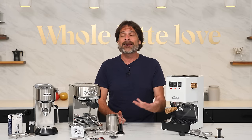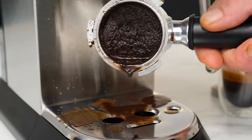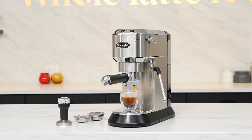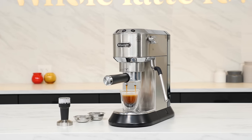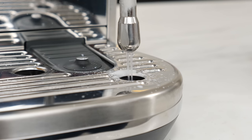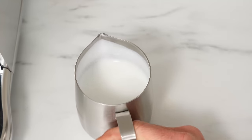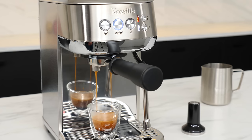So which might best fit your needs? All come with pressurized filter baskets, so you can start without a grinder. When you want to upgrade your quality, you can add a grinder and go non-pressurized with all except the Dedica. If you're okay with average quality espresso, the effort of cleaning out soupy pucks, or know you'll only brew with ESE pods, you can usually pick up the DeLonghi Dedica at the lowest price. If you like convenience and want to froth to latte quality with no skill required, the Bambino Plus does it automatically. Some users will find the automatic purge feature useful — just lower the steam wand and the Bambino Plus takes care of it. Like the Gaggia Classic, it has a three-way solenoid for dryer pucks. Steaming times are good and it comes equipped and ready to go with extras like the frothing pitcher and tamper. My concerns are the lower max coffee dose and potential points of failure with the extras under the hood for the automatic features.